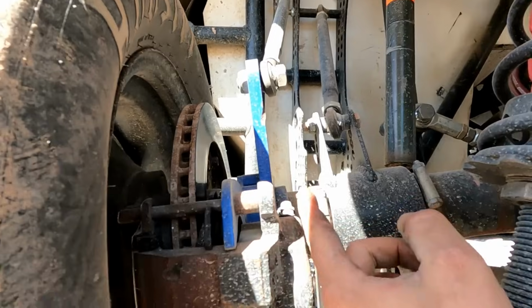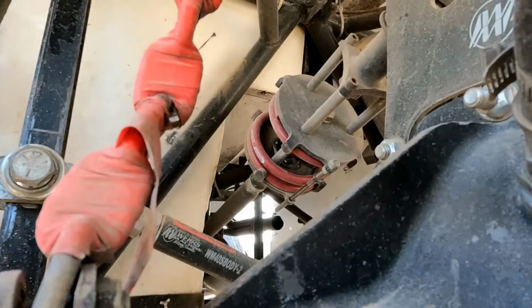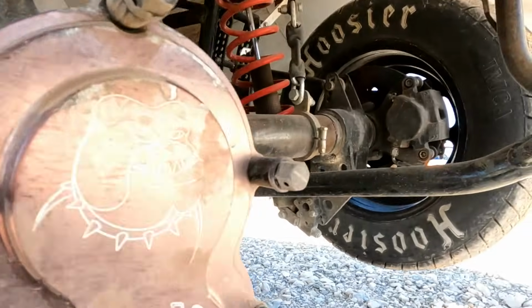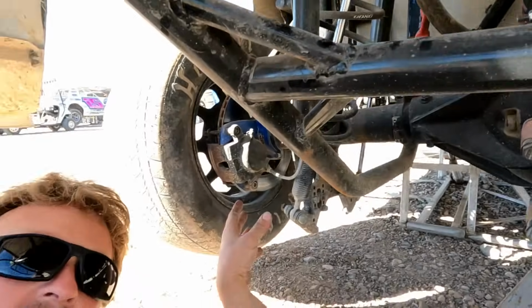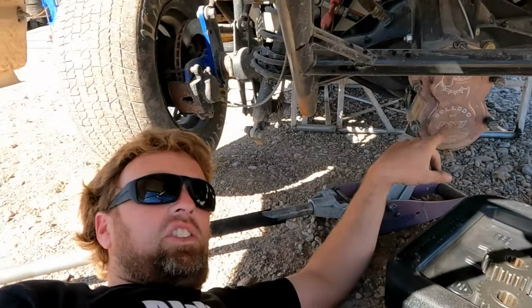And that's the bar that goes up to the chassis. Coilovers, you have a spring-loaded top link to absorb torque away from the engine on dirt. Same thing on the other side. And you have a J-bar too. This crazy rear suspension on these things compared to the asphalt cars I used to race. And there is a crap load of adjustments, and I've had to relearn everything with that. But back to changing the gears.